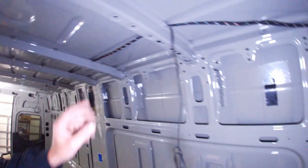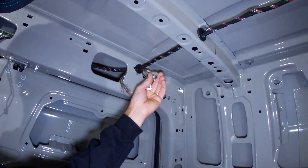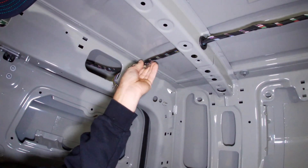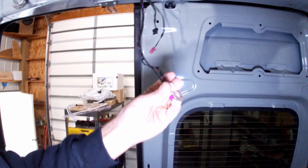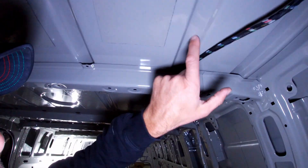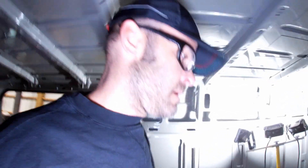Once you get through this area right here, you want to take some electrical tape and tape all of these grounding lugs so they're flat, then tape them to the wire so they stay flat. You want to tape these together so they're flat-ish. The reason you're doing that is so the wires can sneak up and over the ceiling rib, below the roof skin. You can do that right at the start if you want — I did it just before going over the ceiling rib.